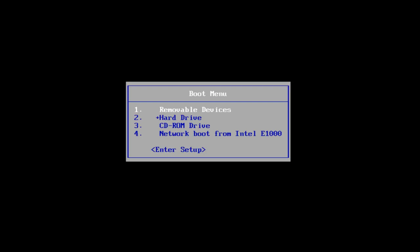Depending on your computer's motherboard specifications it's a little bit different on exactly how to get to the boot menu, and it might look a little different. Generally it's going to be the Escape key or the F2 key. I'm using the Escape key to get to the boot menu here, and I'm going to boot my computer off of my CD-ROM drive. You can go into your BIOS settings and change the boot order to boot off of your DVD or optical drive first, but I'd recommend just using the boot menu — it's a quicker one-time deal and you don't have to go back into BIOS later to change the settings back.